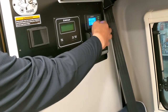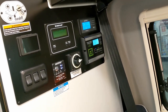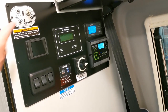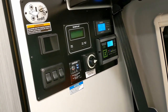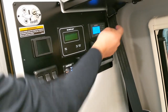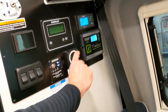Now I've turned that back on — the 110 is powered up, so your outlets will work and you can turn the AC on. That's the only thing that runs off of it, and it's a 2,000-watt inverter. You never have to touch that secondary switch — with that one off, you control everything with the primary one.